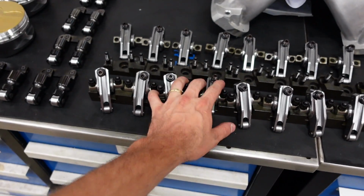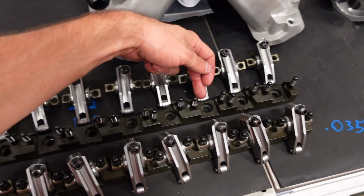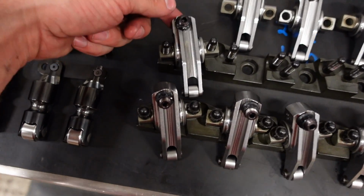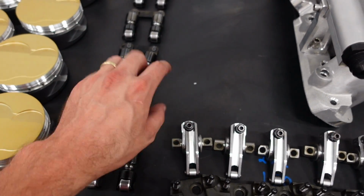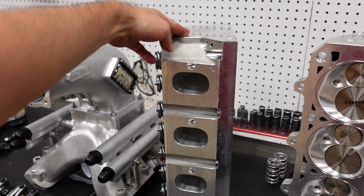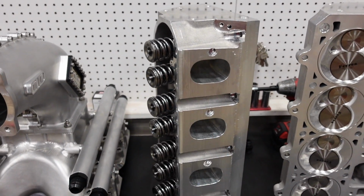Valve train is going to be handled by a steel T&D Machine rocker shaft system. This one tool steel shaft will bolt down to the cylinder head, and then all of these steel full roller rocker arms bolt to the shaft, just like so on these studs. Then you can get behind it with your lash adjuster and set your valve lash. Cylinder heads are from BES Racing, Tony Bischoff Racing, and these are a huge oval port custom power adder specific LS cylinder head.